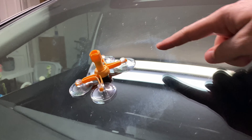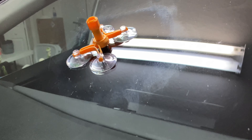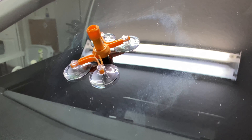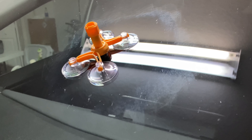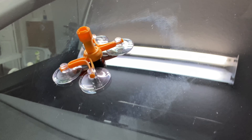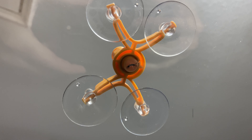Also be sure to clean the windshield real good. I wiped around the crack thoroughly so there are no issues. The suction cup sits on it really nicely, and when we put the resin in there are no issues with loose glass or dust. Just be sure to do that as step one.